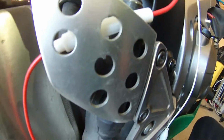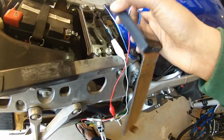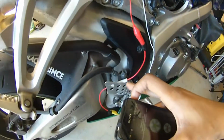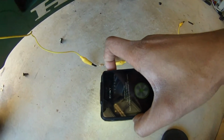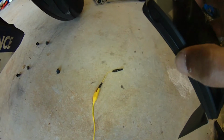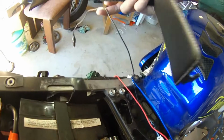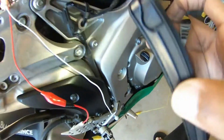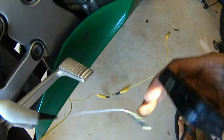So basically this, I've color coded it just so that there's no confusion. This red line here will be connected to the positive terminal. That's in line with the fuse holder, and that goes to the yellow wire, which is connected to the 100 ohm resistor, and that's our positive terminal. It's keeping things simple. And the negative terminal of the battery, the black wire, is connected to the white, because as you remember it was a yellow white stripe. And that will be connected to the green-orange line.